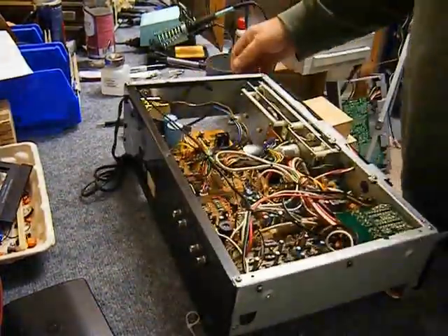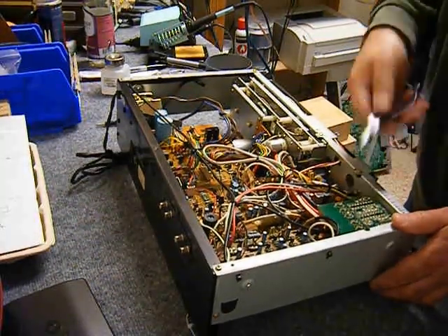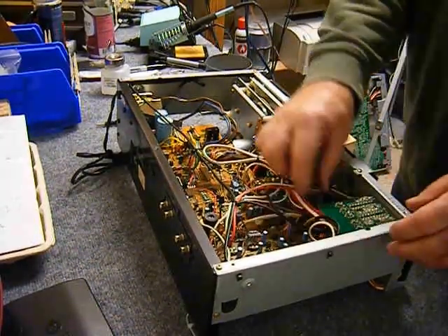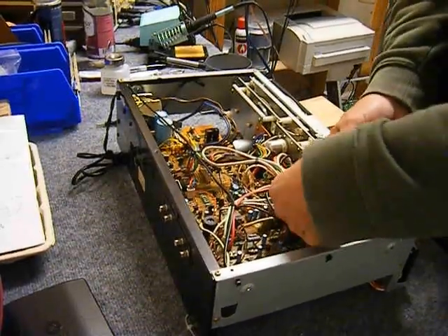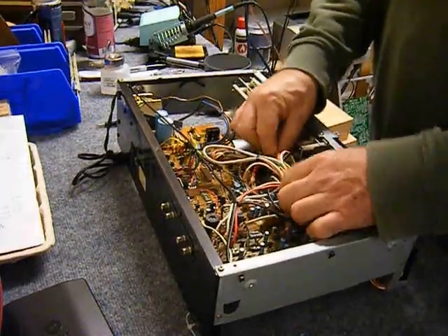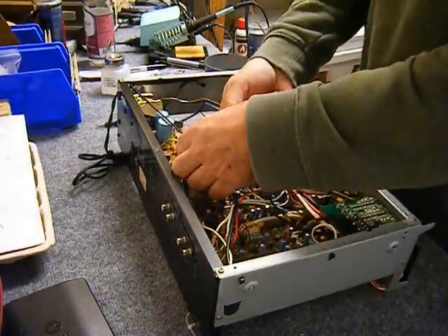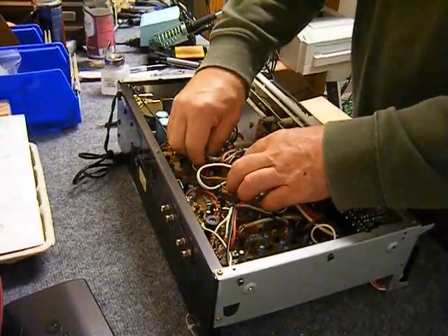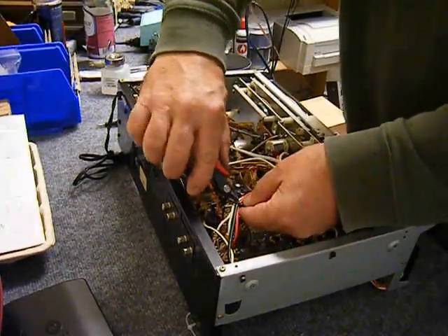The things you want to undo are the record-play switch operating cable. There's a cable — it's kind of like a brake cable on an old bicycle. It's not an electrical cable, it's a mechanical cable, and it's used to move the record-play switch into record or play as appropriate. Then remove the connectors.